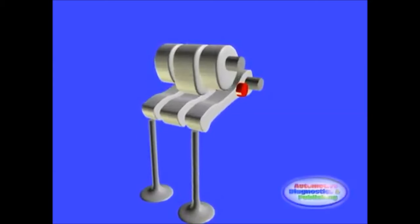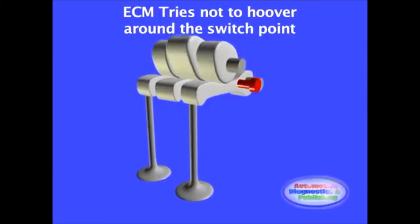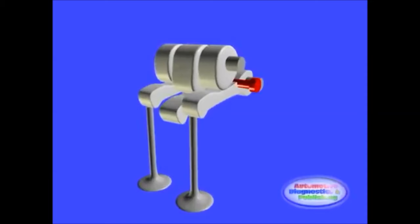The switchback from high to low RPM lobes is set at a lower engine speed than the upswitch to avoid a situation in which the engine is asked to operate continuously at or around the switchover point. In other words, the ECM avoids staying at the switchover point during cruise. The VTEC system is found on dual overhead cam systems, as well as single overhead cam engines.